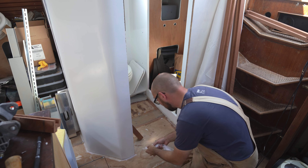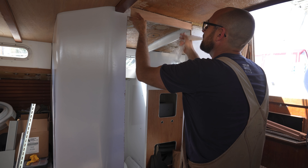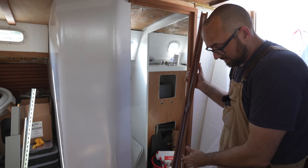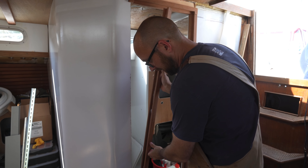Eva did a great job washing the deck — it looks beautiful and very much ready for KiwiGrip. Now while I was up at the workshop sanding, I also cut a small piece of plywood that's going to fill the gap over the door frame. This counts as the final test fit. Let's go ahead and get all of this adhered in place with a little bit of thickened epoxy. I'm hoping we can get away with just using thickened epoxy on this little top piece — if not, we might have to lay up a little bit of glass, but this should be plenty strong enough.